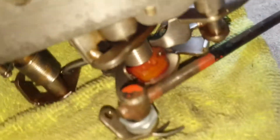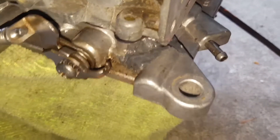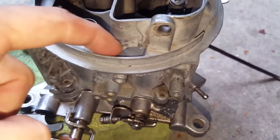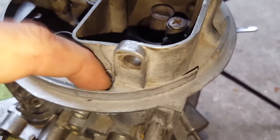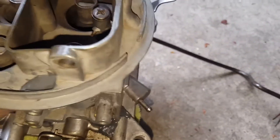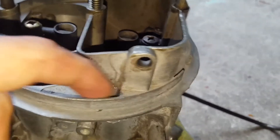As far as the rest of the carburetor goes, I've got the orange — maybe red — cams in there and just a smaller-size accelerator pump. I had a throttle plate issue — just a hairline crack — I didn't like it so I JB welded that a while ago. I saw something in another video — I think it goes back to a forum post by a guy named Hanger — where the choke would have gone here, with a plate across and a lever going down. I plugged that hole with JB Weld.